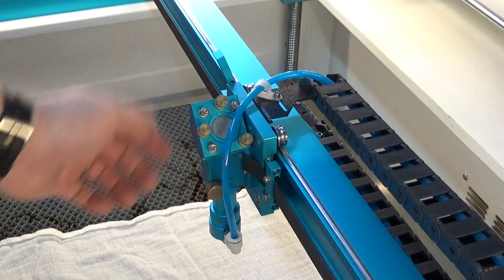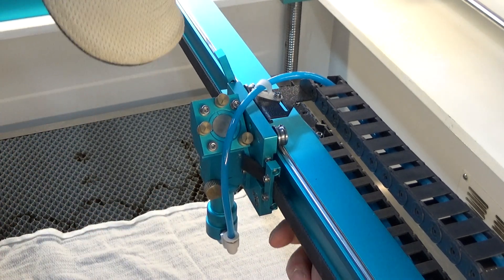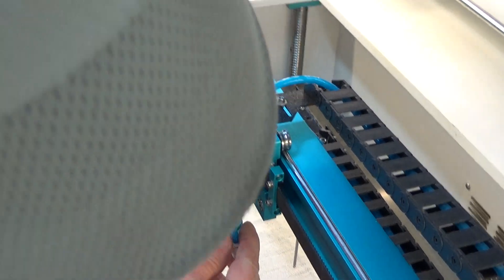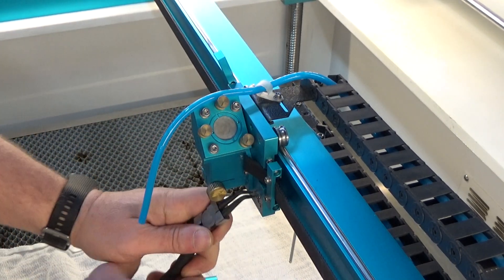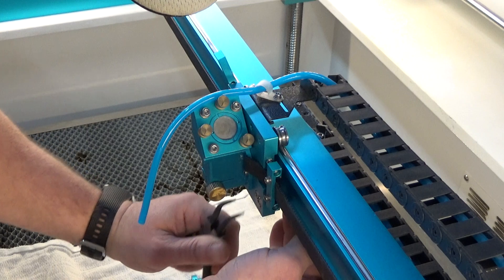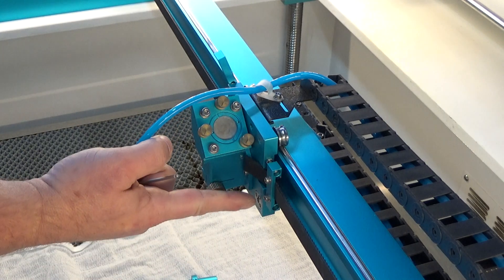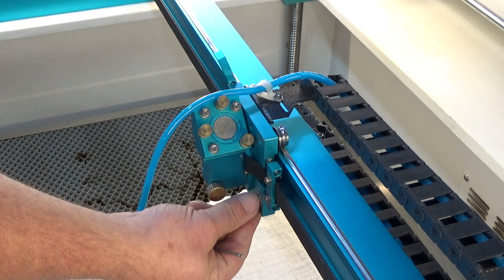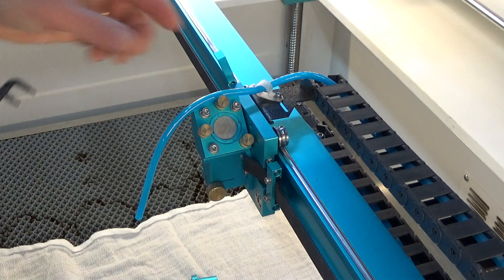On the bottom ones, you'll do the same thing, but since they have this eccentric cam on them, I would highly recommend that you break them loose. You may even want to remove your head to make it a little easier. Hold the cam in place and back it up with a wrench when you tighten them down — don't rely only on the set screw. If you put too much force on it, you're going to cause that cam to turn anyway, and it's going to score the inside where the set screw is supposed to sit, which may cause issues.